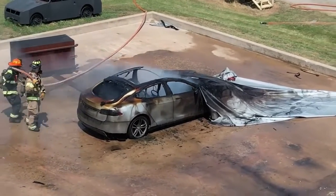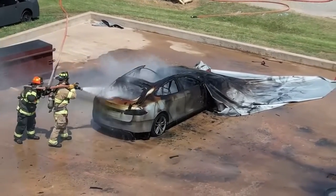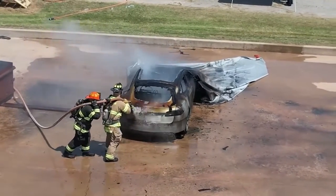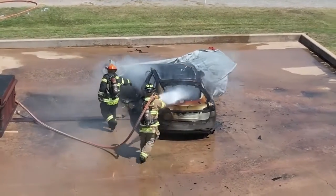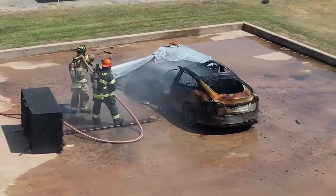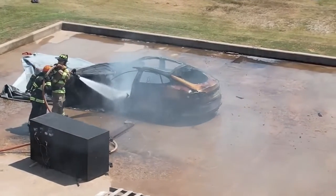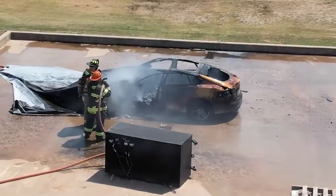We suggest that the blanket actually goes with the company that is picking up the vehicle, and to keep that vehicle covered with the blanket, because there's always the possibility that the fire can reignite. It's not uncommon when dealing with lithium-ion batteries that it does reignite at some point — they can reignite up to 30 days after you extinguish it the first time. That's why salvage yards don't really like these EV vehicles, but if they keep it wrapped with that blanket for that length of time, it will be okay.